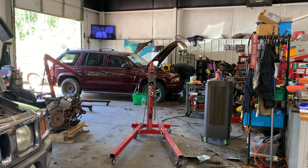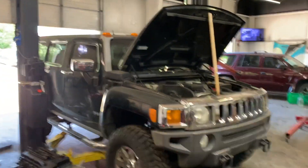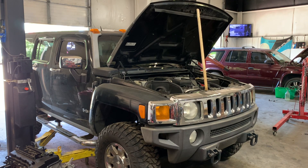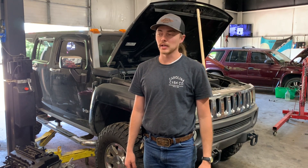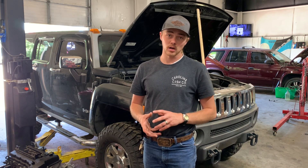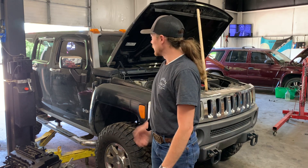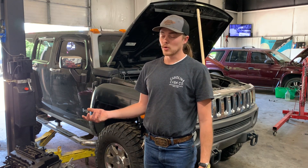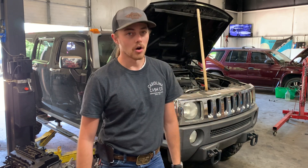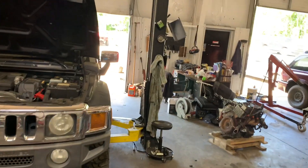He just drove five and a half hours one way and didn't miss a beat, even with a wrecked front end. But something that is missing a beat is this poor Hummer H3. Like I said, we just got the transmission back for the second time from the rebuilders. Hopefully this one works — the last one made it about 29 miles before the torque converter would not lock up. I was having hard shifts in drive. I pulled the trans pan down to check the fluid and the wiring harness inside the transmission was full of metal — just looked horrible. So it's back down here ready to go in.